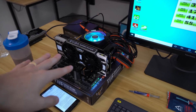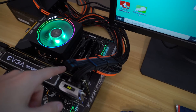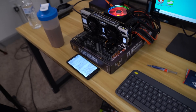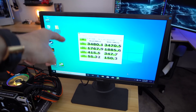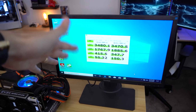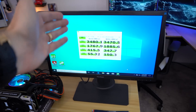I wanted a baseline before we did anything else. You can see this is a test system here: GTX 1070, 2700X, the Wraith Prism cooler, and 16 gigs of memory. The B450 Plus Gaming motherboard. Speeds are pretty much capped out for our MP600 at the Gen 3 limit — about 3,500 megabytes per second reads and sequential writes. So this is what I expected pre-BIOS update. You could still buy a Gen 4 drive and get Gen 3 speeds.